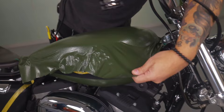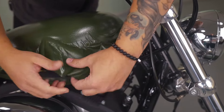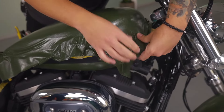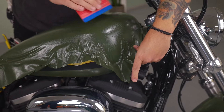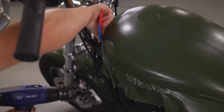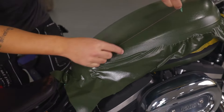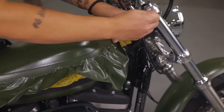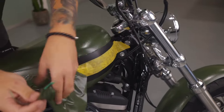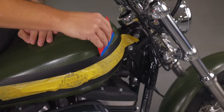On this section, heat the film gently and evenly pull the material to the outside edge — be sure not to pull too hard. Once the film is right on top of the knifeless tape, squeegee it into place, then repeat the same steps for the other side. Once both sides are set, add heat to activate the adhesive so the film holds position, then simply release the knifeless tape in a long steady pull. Work from back to front, pull the excess film away, and as you can see there's very minimal tension on the edge. Squeegee it into place and repeat the exact same steps for the other side.